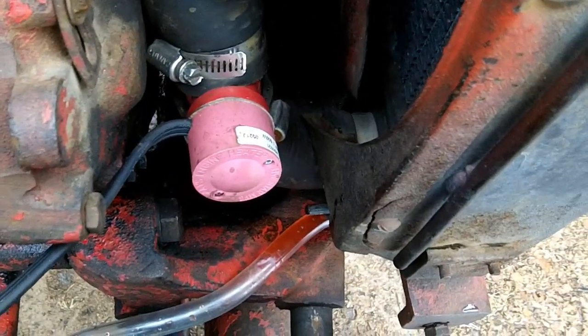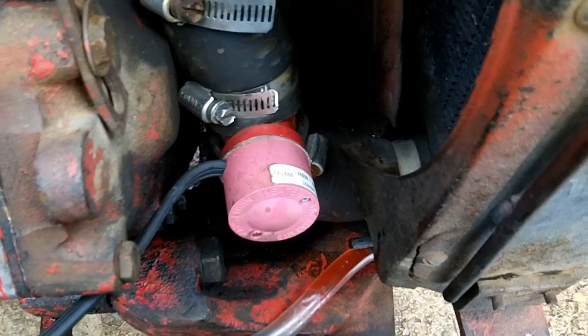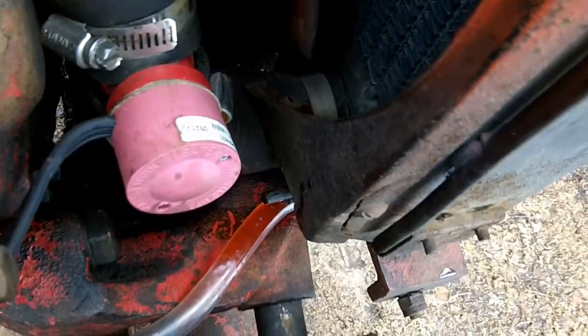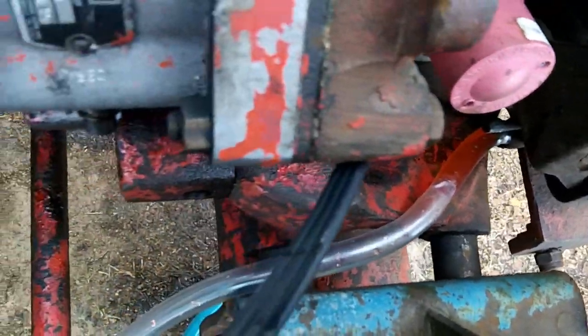She hasn't been heating up. It's only a year or so old — couldn't have been a very good one or something. It wasn't turning on or anything. What we're going to do is drain the radiator. We put a hose on the petcock at the bottom of the radiator hose.